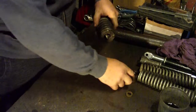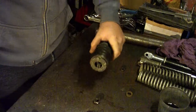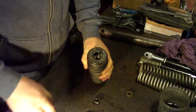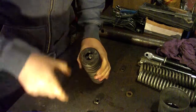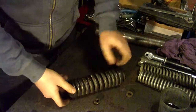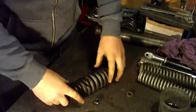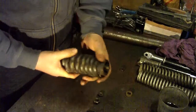So when you remove this bolt, you will be able to remove the swing arm. Now, since this part has been damaged, I don't know how to remove it correctly, but I'm thinking that since there are two holes here and here, you probably need to have some tool to install in these holes and then spin it or unscrew it out, same as the front shock absorber. And after you remove this bolt here, you can remove it out.